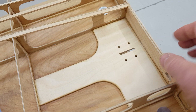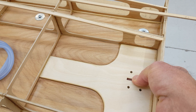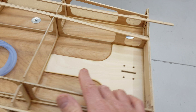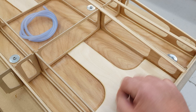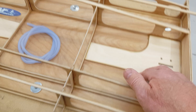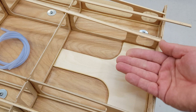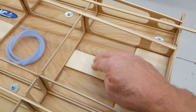We've laid down a little bit of structure in here, reinforcing the floor where the strut goes, and we've made our strut mount — we'll talk more about that in an upcoming video. This is eighth inch laid over top of sixteenth inch; it's very, very stout. I ran it all the way forward. Don't do what I do — do what I tell you: try to build it really lightweight. I added it because I thought it looked cool, but it does provide some structure to the floor. If I ran it straight across it could flex somewhat easily, so I told myself it increases the strength — and that is a good thing at the strut.